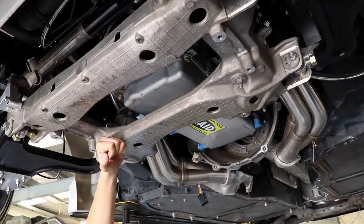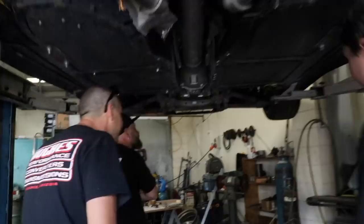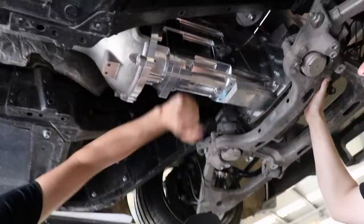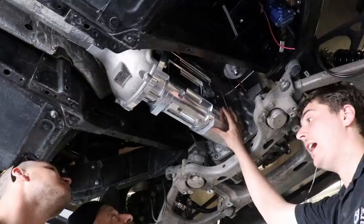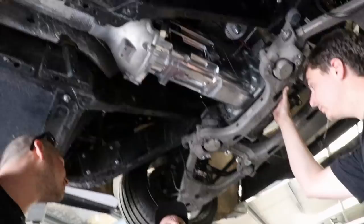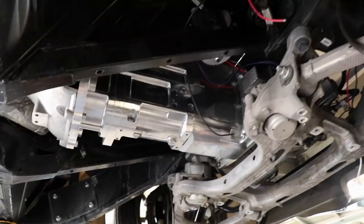Yeah, yeah. The cool thing is the business at the back, which I know Al's been sussing out. So come suss this out. And Blair, you can tell us more about this. We've been talking about it over the last half an hour once we've had a quick little workshop tour. So, sequential gearbox. This is in the transaxle in the back. This is the 6-speed HGT box, and then we've made an adapter to actually fit it into a factory C7 Corvette. So it runs exactly how it would the factory gearbox. Very cool. The torque tube thing is something different. These things are a fairly impressive bit of engineering as it is. Then you go putting billet transmissions in them. That's really cool. I like that. It's all caged up and everything, we can see.